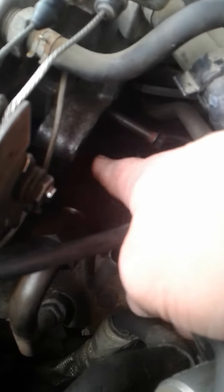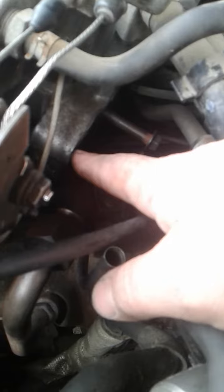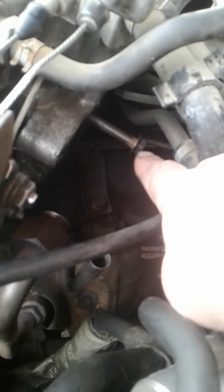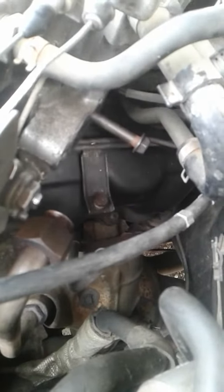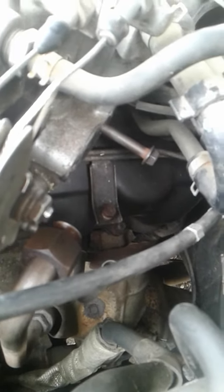Like I said in my cleaning shot, I had lost this bracket and it fell down into the engine. So I'm going to try to do that right now. Put this bolt in first, angle the EGR up, put the bolt in, tighten it a little bit, pull this bolt out, and then put in the second one. That's my plan.